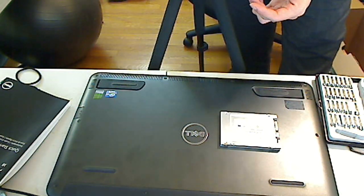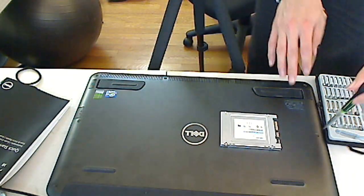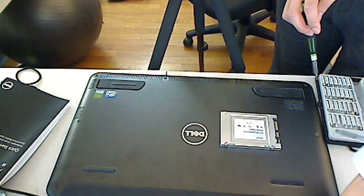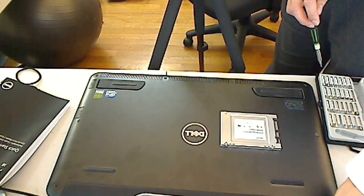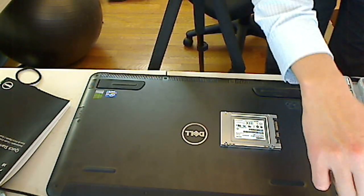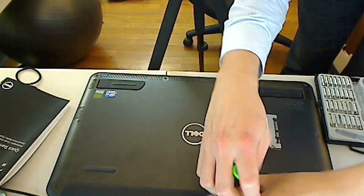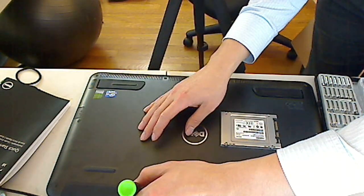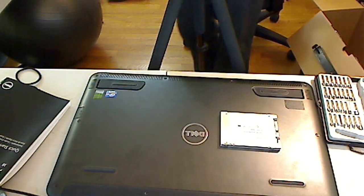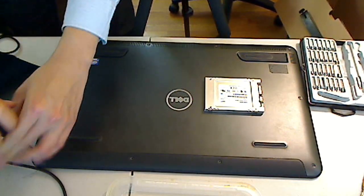What I would suggest is getting one of the CyberDoc magnetic mats — it's like a project mat that's magnetic, so you can place your screws on it and not lose them. A little tray box will work too. The important thing is you don't lose your screws because you're going to have to put them back later. Also, when you're unscrewing, make sure you have the right tool and you're matching the groove evenly before you start to torque your screwdriver — that way you won't permanently damage the screws.